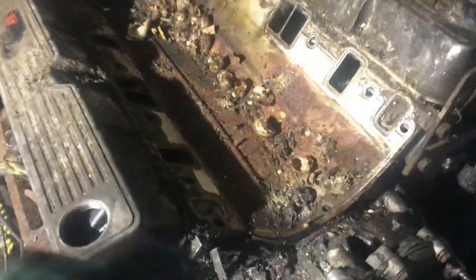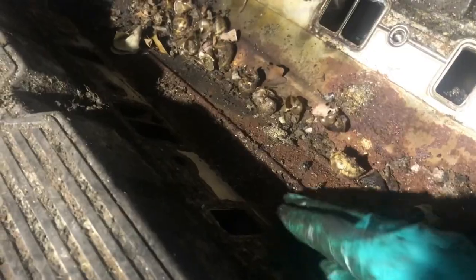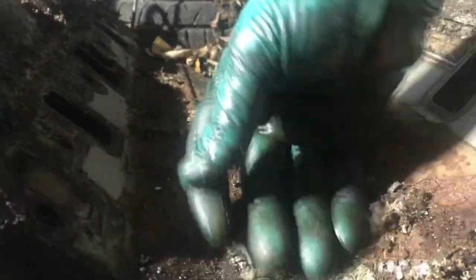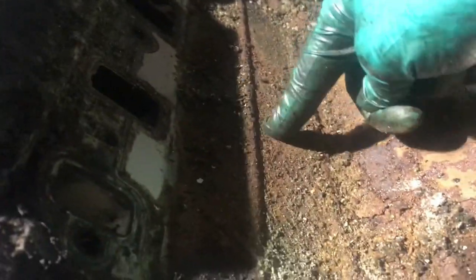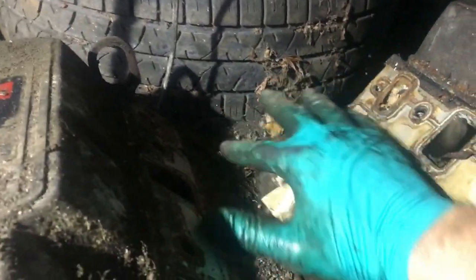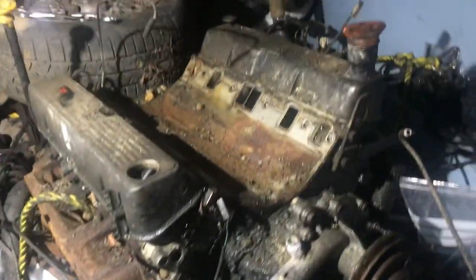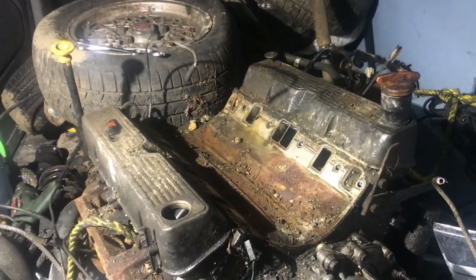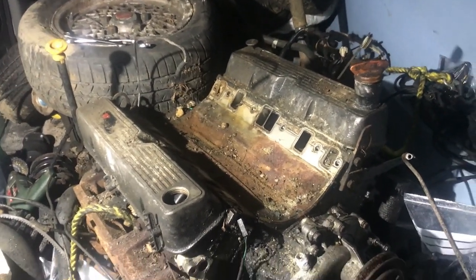Just a little observation: you can see the valley gasket has blown up on this side — it should be a nice smooth valley curve, but this side has all lifted up. That's probably due to internal pressurisation from a blocked filter or something. It's usually not a good sign, as it's evidence of a slightly sick engine, but we shall find out in a moment just how sick.